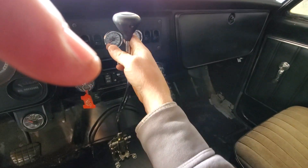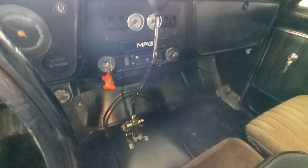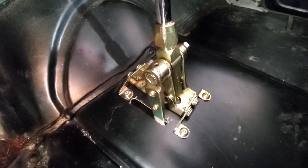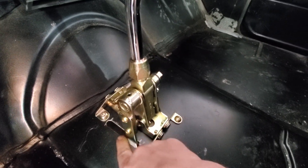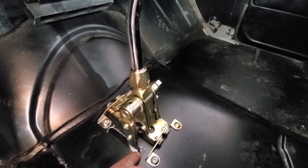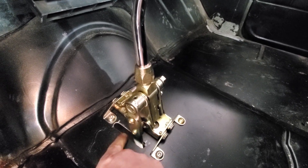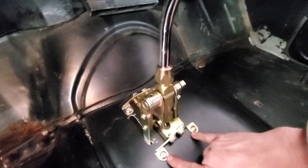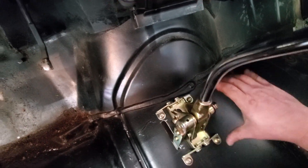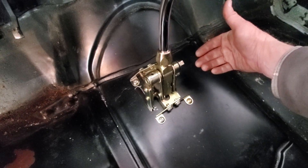The way it works is: to shift gears you push that button in. This is a top floor mount. The only hole you have to make is this slot right here, which you find your range of motion. Once this arm is on, you center punch it, you drill two holes, you take a reciprocating saw blade off a jigsaw, and you cut these straight. You do have to drill four other holes — these two as well as two on the top side there.